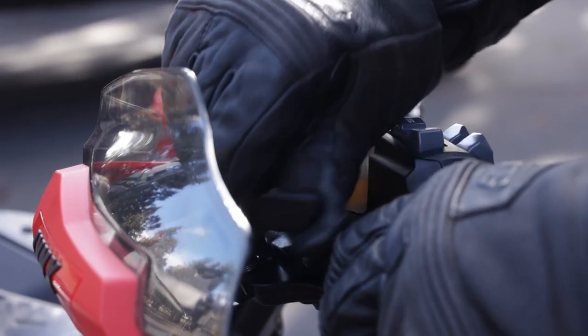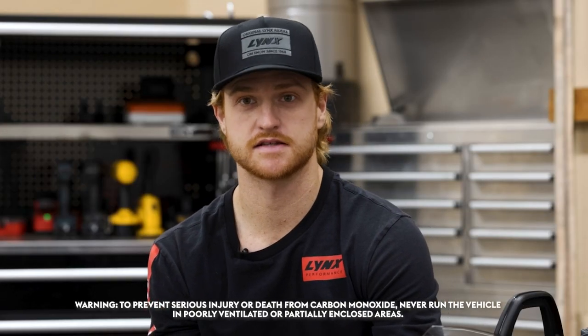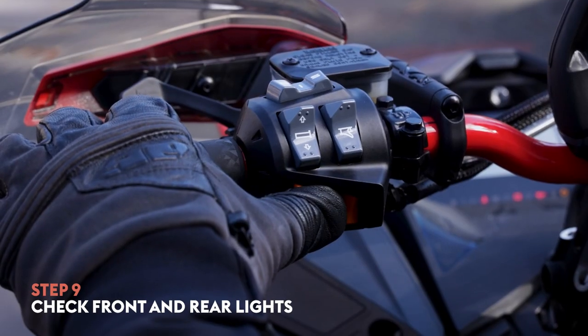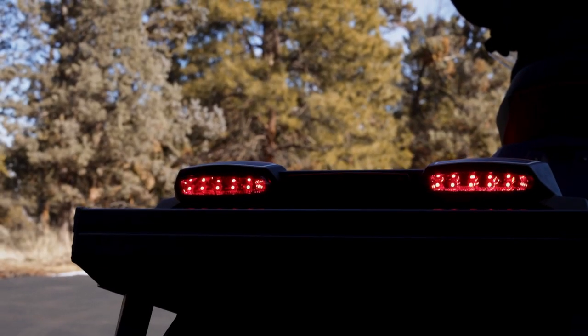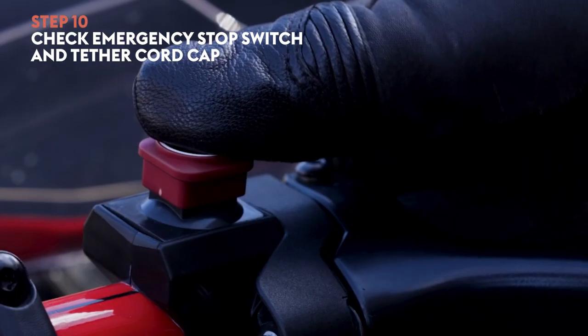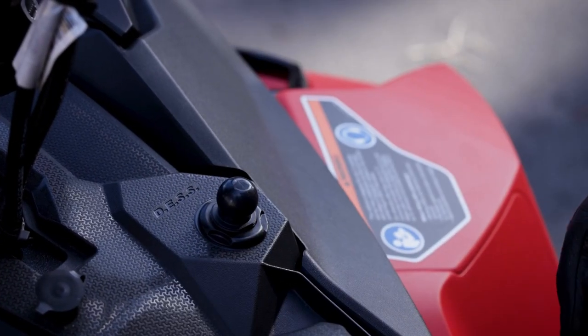Now it's time to put on your helmet, set your parking brake, and start your Lynx snowmobile to check off the last few items on the list. Make sure you always attach the tether cord to your jacket before starting the snowmobile. With the engine running, check that your headlights are working properly on both low and high beam settings. Also check that your tail light is working and the brake light lights up as well. Finally, you'll want to make sure the sled properly shuts down when you push the red emergency stop switch, as well as when the tether cord cap disconnects from the sled. I usually test the emergency stop switch first, restart the sled, and pull the tether to ensure both engine shutdown methods are working properly.